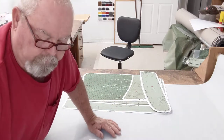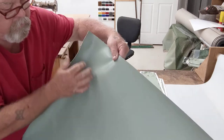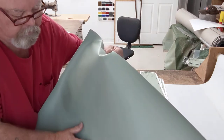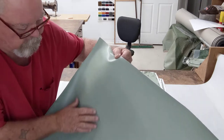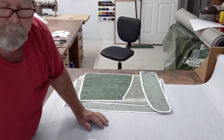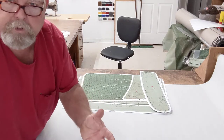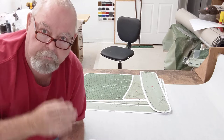This has a few little puckers in it. They will come out with the heat — it was rolled against the dielectric material. I brought it up to the owner; he's cool with it. But any time you get material, don't leave it sitting on a shelf, especially a steel rack. They will permanently put marks in your vinyl. Cloth is real forgiving, of course.